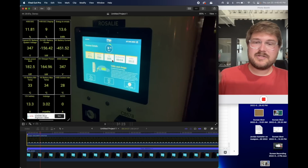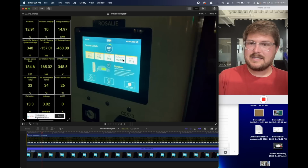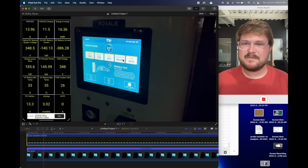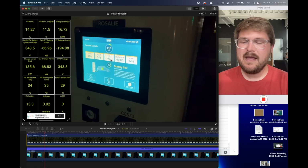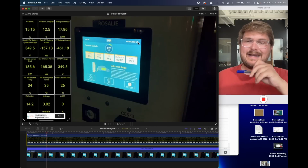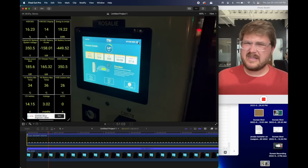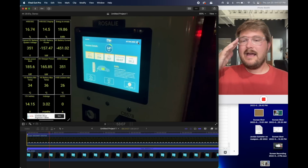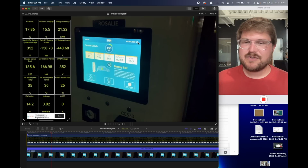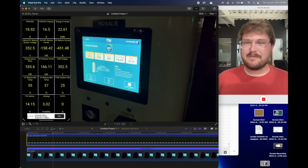We've reached almost 10% in 5 minutes right here, and the truck's going to do some wonky stuff as we move forward. It's actually going to see this power dip as it comes and goes, and I'm not sure what's going on here. I saw this with the Mustang Mach-E when starting at 0% state of charge, and I don't know if it's doing a battery pack check, or trying to prevent lithium plating, which at this power level I don't think we're even close to. But I've only seen this on this truck starting at 0. Any other time I've charged the F-150 Lightning, I have not experienced this. I have experienced it with the Mach-E early on though.